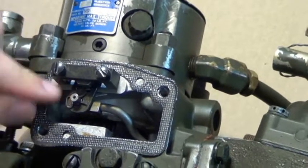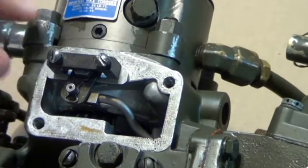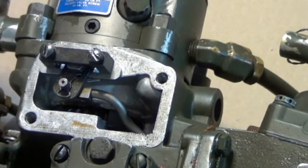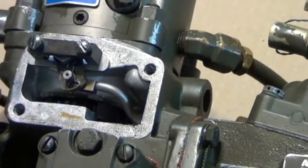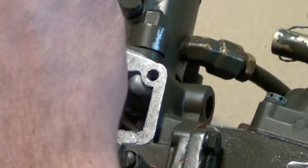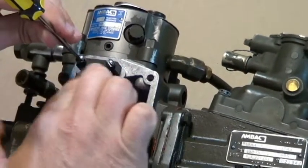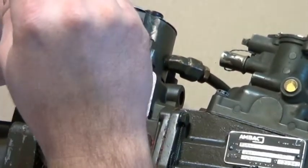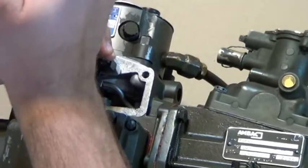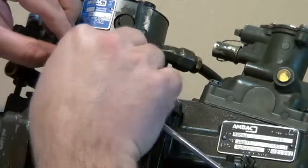Here's your fuel shutoff lever. Let me zoom in on that. This sometimes will get stuck — that'll be another reason sometimes the trucks won't operate. See how that one's kind of hanging up? That shouldn't be that sticky. When you put the new O-ring set in, normally there's tie wire across here. We'll be putting a new tie wire back on it. If you loosen these screws up just a little bit, this will get really easy to move — usually. Well, this one's a little gummed up.